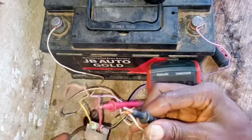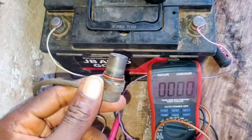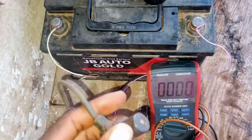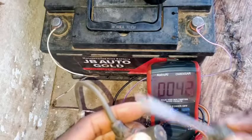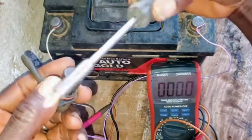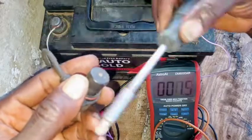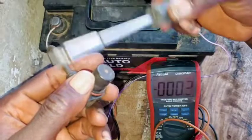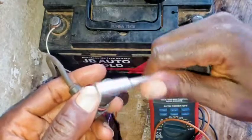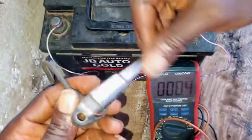This is where the magic happens. Keep your eye on the multimeter — this is exactly how your car's crankshaft position sensor is designed. When I swipe this metal across the sensor you start seeing a reading. You can see the signal is generating. Each time your crankshaft moves towards it, that is how it generates a signal and sends it back to the ECM so it knows which cylinder to fire and which not to fire. If you're seeing a reading like this, that means this crankshaft position sensor is good.